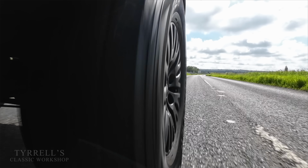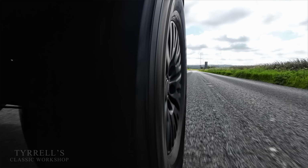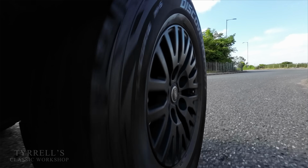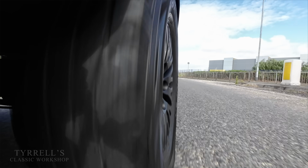We'll just try it again. Oh, and the engine is actually coming alive. Those spark plugs, as I say, were not actually working properly. They're precious metal-tipped spark plugs in this, iridium-tipped spark plugs. And it doesn't take much. If a cylinder is misfiring or they're not getting a good spark, they don't like it very much. They tend to start packing up and failing, and that's exactly what had happened with these. But it is definitely on 8 pots again.